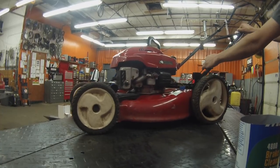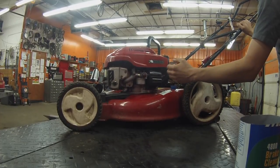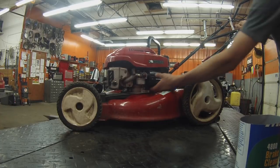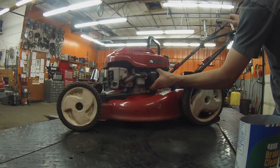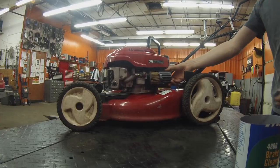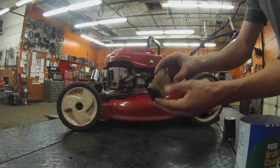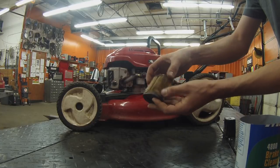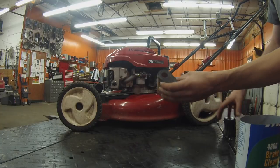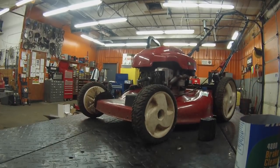While you're working on your mower, a couple of things to check: everyone says check your air filter and spark plug, but to tell you the truth, they're not a huge issue unless you see something apparently wrong. Here's our air filter — on a Tecumseh it's a 30-degree twist lock. Pull it out with the filter. This one's not too bad — I'd probably change it because it has dirt and oil in it, but it's not going to cause it to not run. Only if it's packed and completely suffocated would it ever prevent starting.